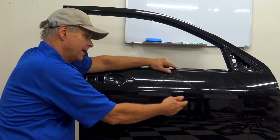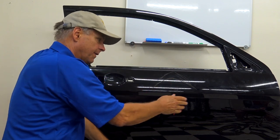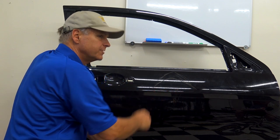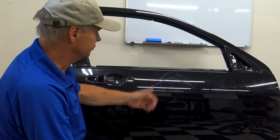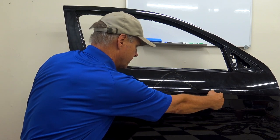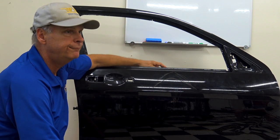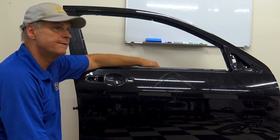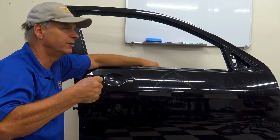After that, you can maybe with a slide hammer just kind of hit that body line and take some of that out. But usually, you're going to notice that if you do that, there'll still be soft little lows on either side. That's your body line screaming at you. If you can get a flat bar down there, that's the ideal tool. Remember, take the diameter, start at least 50% either side, and you just sharpen up that body line all the way into your dent. And even then, as I'm doing that, I will stop occasionally and look for what? Horizontal pressure traps. Absolutely. If that body line is not moving up easily, something's doing it.